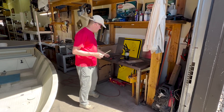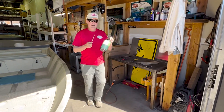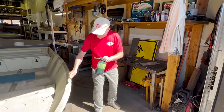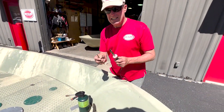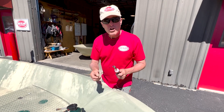Before I plastic weld, I'll have a soldering iron of some shape or size. I like to preheat my plastic — when I preheat, I use a blowtorch. I'll light the torch and preheat until it just gets gooey like a little marshmallow. I'll also have something to clean my little welder, like a wire brush.